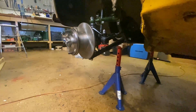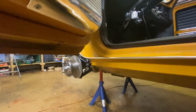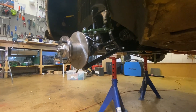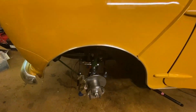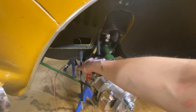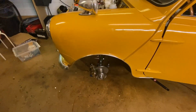Now I'm applying some throttle — let's see the wheel spin, and some brake as well. The drive shafts I have right now are not hardened steel — they came right off the mill. The firm I contacted saved me two unhardened pairs and sent the other two to the hardening firm. It will take about one more month to get the actual hardened drive shafts, so for now I have temporary ones and I'm definitely limiting the torque quite a lot — currently set to 20 newton meters, while the maximum is 195 newton meters, so only about 10 percent.